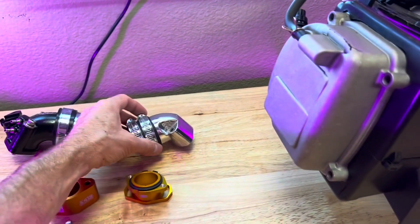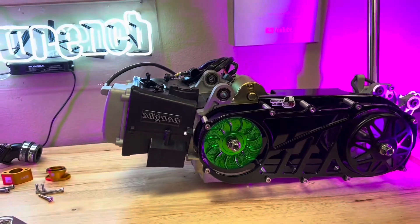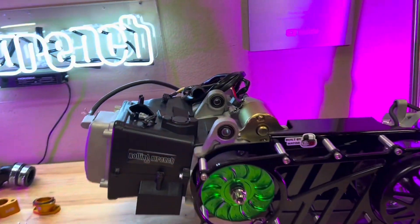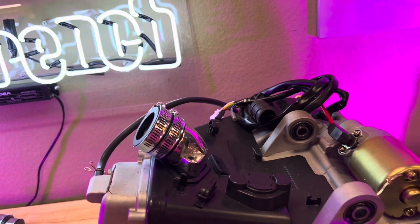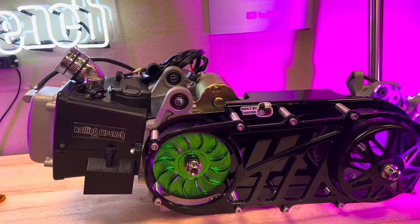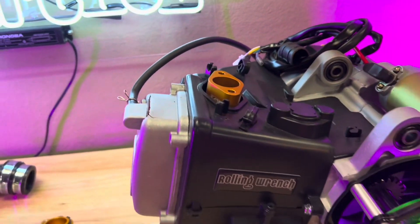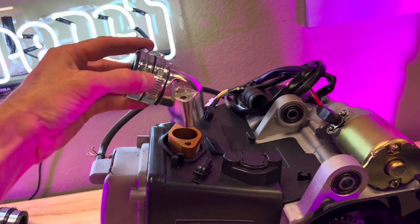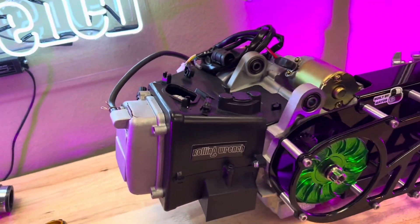If you're new to the Ruckus scene, you're probably wondering what I'm talking about. Here's the GY6 engine that's going to go in a Honda Ruckus, and we're going to do a fatty rear tire just like this. If you're not doing a fatty rear tire, you can just attach your carburetor with no leveling clocking flange — no problem, it'll just go on like that. A lot of guys will run a spacer like this so it clears the frame. Just imagine this is your carburetor — this is an intake manifold to the carburetor. Let me show you why you need a clocking flange.